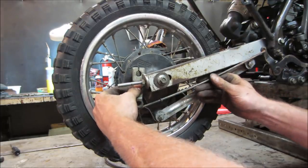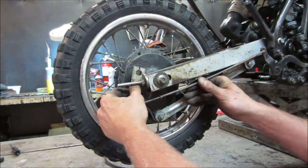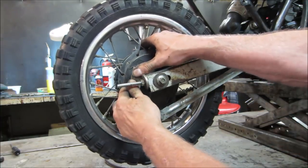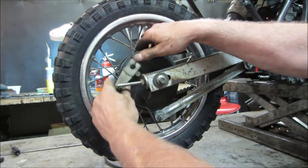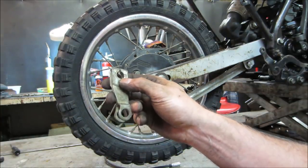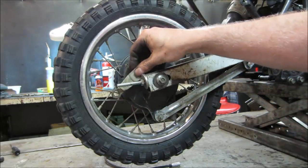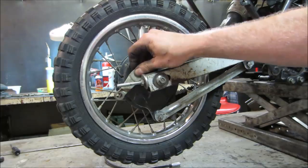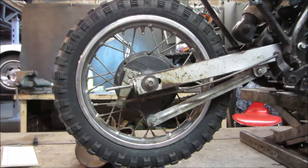And if we go, we've got to be out by the threads. And how far does that pull before the brakes come on? Pretty far. Sometimes these are keyed. There'll be like one tooth that is squared off so you can't change position, because a lot of people do that to cheat when their brakes are failing. Let's eyeball that. I'm going to tap that on one location and see if we can find a happy spot for it. And after everything's tightened up, that should work out pretty good.